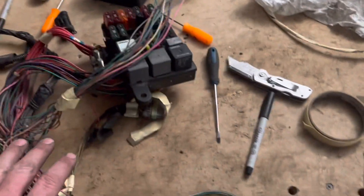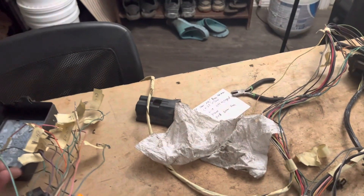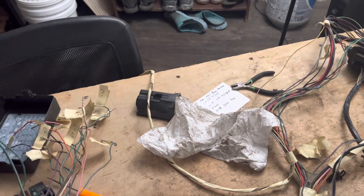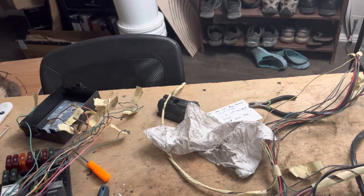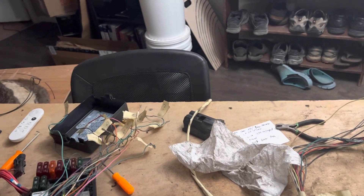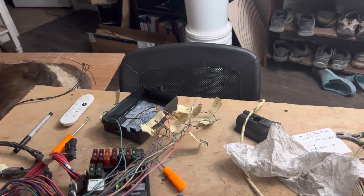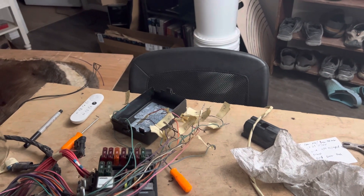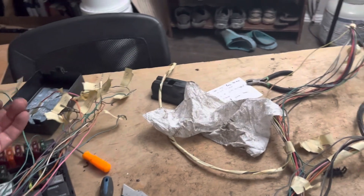The way I'm going to do it: I'm going to leave it exactly how it is. I'm going to send the AC request to the LS computer and get the signal back from the computer to activate the clutch relay. Both of those signals will go back and forth. On the LS side, I'll have to ground the low side input, and I'll have to see what I need to do about the high side — whether to just leave it out or ground it. I'll make it so the LS computer is told that conditions are acceptable, and I'll physically run the conditions through the request the way the 96 did it.